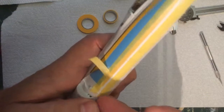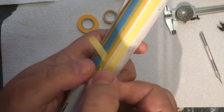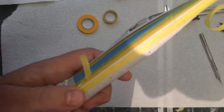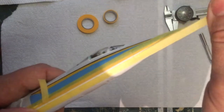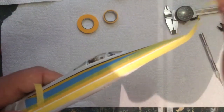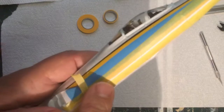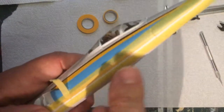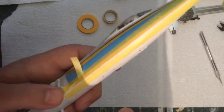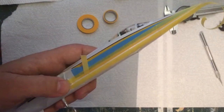I have the marker tape pretty much right where it should be thickness-wise. I laid the main tape on with its edge right on the point of that marker tape, then took the rest and eyeballed it right down to the front point. Everywhere there's a panel line — here, here, and here — I'll compare the thickness I just masked off with the thickness of the stripe right above it, repositioning the tape until it's right where I want it. It gets a little time-consuming, so I'll do that off camera.